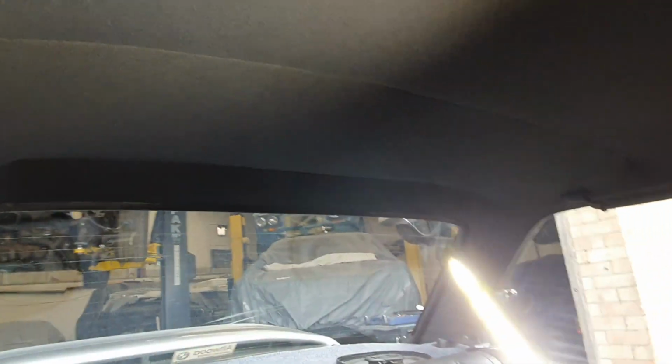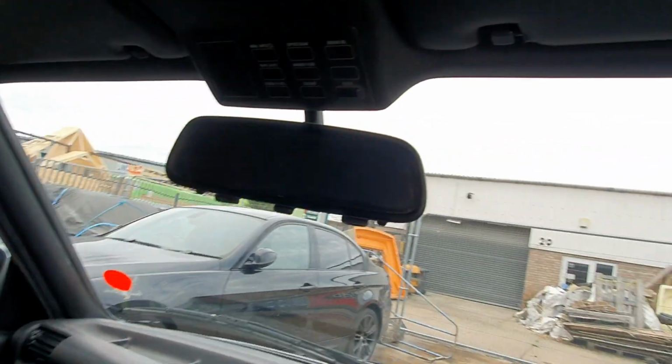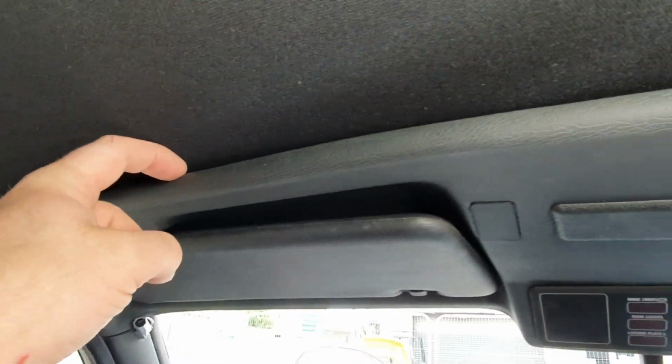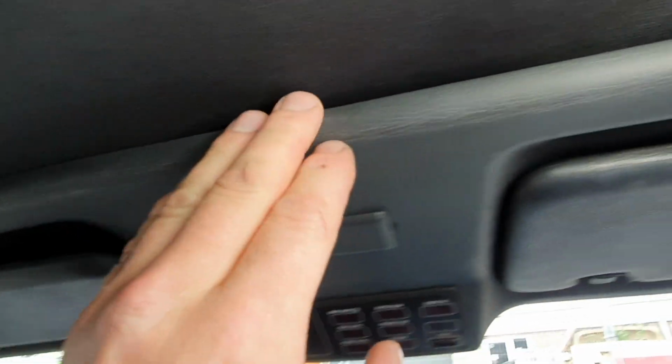I'm moving forward again, the handles. I'm just going to sit back here and try and get a bit of a shot for you. It is very difficult with the light that's going on at the moment outside, but what we do with the front section here, which is the original E30 sunroof model, is we trim the hardboard. You can see we trim that away where it loops around the original headlining and hull, and then we literally just glue it back on itself,